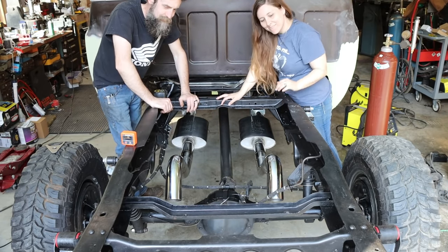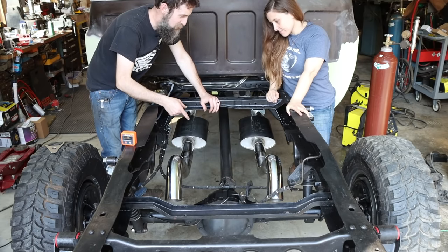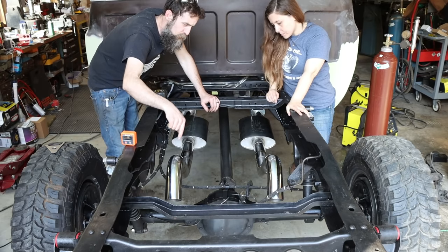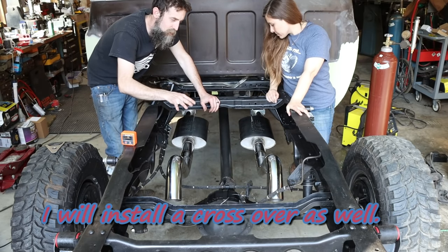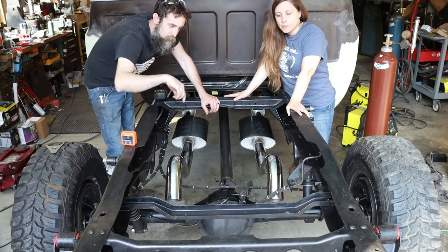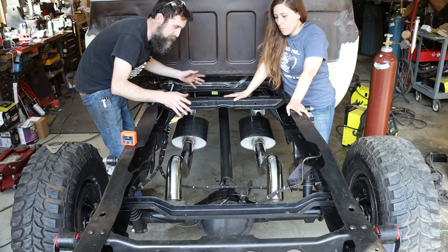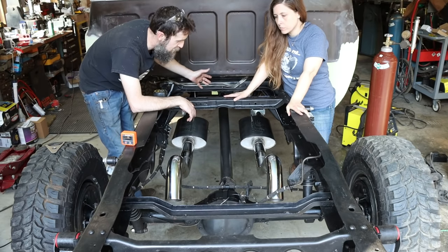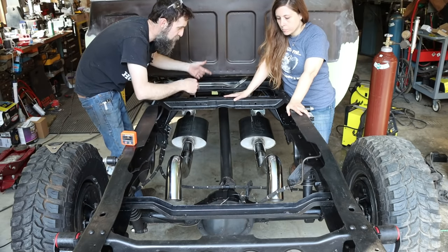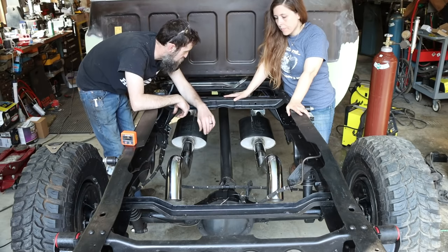That's not good. So I'm super excited about this exhaust system. 3-inch stainless steel mandrel bent tubing, dual exhaust all the way back over the axle, not completely finished yet. Still got to drop down, either go straight out or go out behind the rear wheels. Haven't made that decision yet. But just that kit, the general purpose kit that I picked up, was enough to get me all the way back to here, with the length of the mufflers and stuff. I mean, that's minus the little stainless flex pipes that I got.